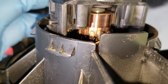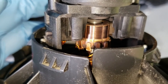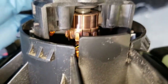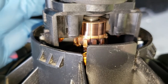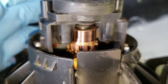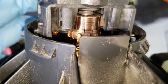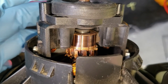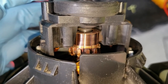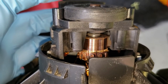An interesting thing that happens to these vehicles — and I don't know why GM doesn't know better — there's a problem with these blower motors blowing brush dust onto the evaporators. Between the brush dust and the type of metal on it, laying on the aluminum evaporator core with moisture from condensation, it actually attacks the aluminum and creates pinholes in the evaporator core. So I was concerned there might be a lot of brush dust on the evaporator core for this customer.